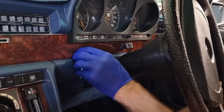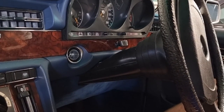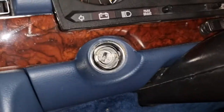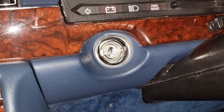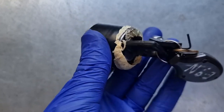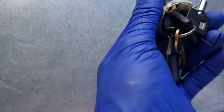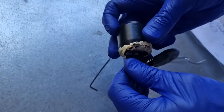Then you will see inside the ignition switch, and if you were to put a screwdriver in there you can turn it with a flathead and the car will start. The ignition barrels are no longer available, and this is a problem. You can see the key sticking through here — the allen key is still in it — and once I take the allen key out I can turn the key back to position zero, remove the key, and the barrel will fall out of the anti-theft device.